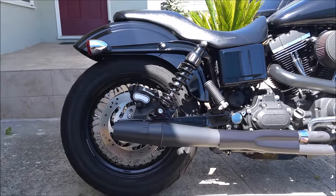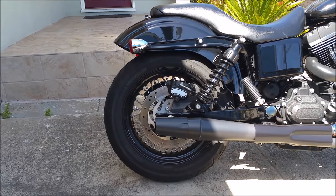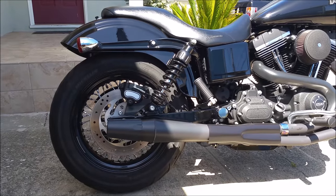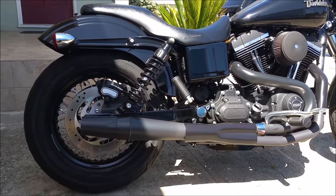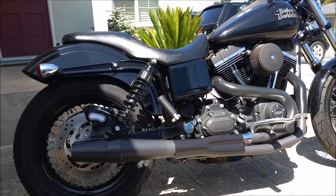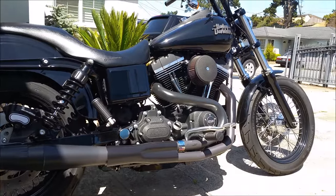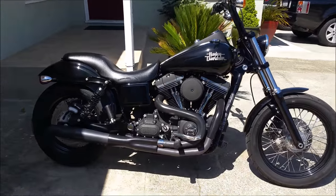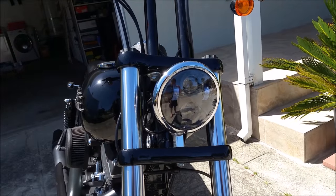In the front you have an option to make it one inch lower or keep it stock — I kept it stock. This one is a 13-inch shock so it raised the rear end quite a bit. It's not a bad look. In the future I wouldn't mind going 13.5, but the 444 only offers 12 and 13 inches — you'd have to go with a different model to get 13.5 or even 14.